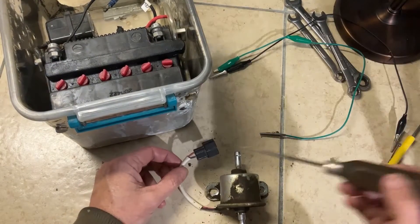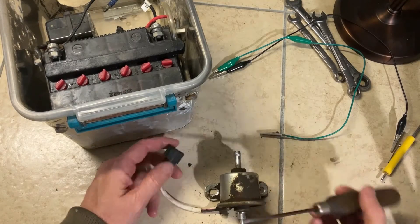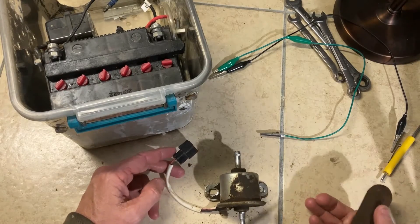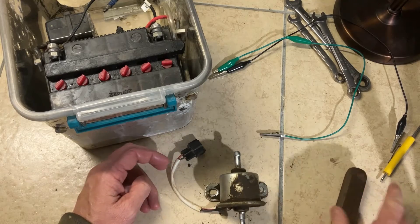You can test these pumps the way I just showed you — on the machine or off — or unplug it and check your wiring harness with a multimeter. See if you have power coming to the pump before you ever mess with the pump or replace it.